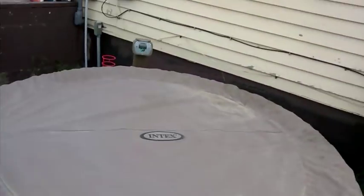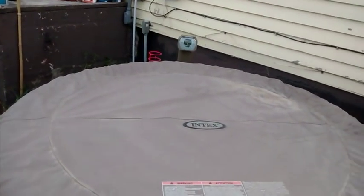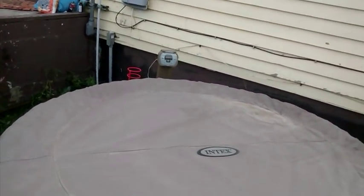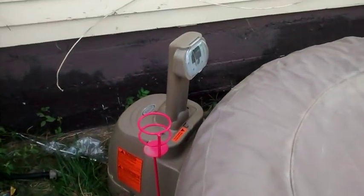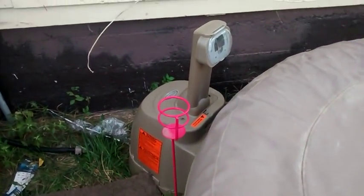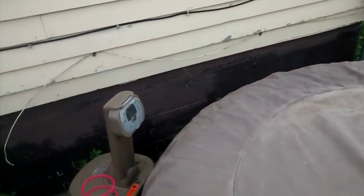So anyway, if you've got any problems like that and you're out of warranty, that's kind of where you might end up having to go. Check condensation. It ends up in there, in that heating unit. Like I said, 4 screws, really easy to take apart, blow it out. Check your connectors where the wires connect together. You just pull apart the connectors, dry them out. Try that, put it back together, and you might have some luck with that.